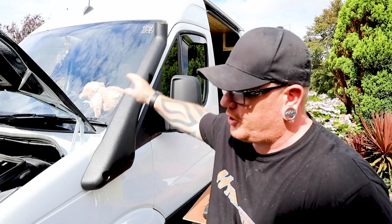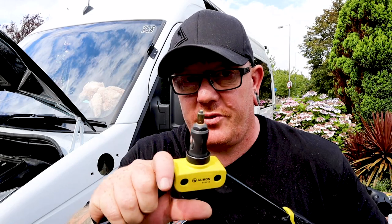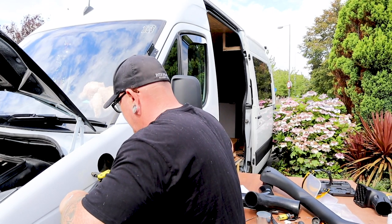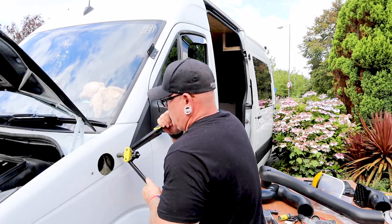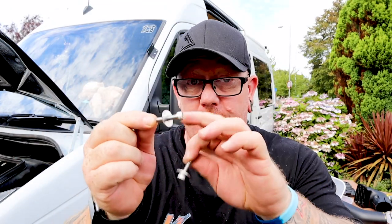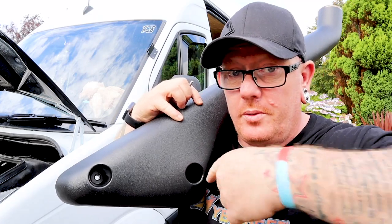So I've just put one of the bolts in the top, then I can actually get in there and mark this hole where the actual rivnuts are going to go. I know that everything at this end is lined up to that end and it's all perfect on the van. Two M6 rivnuts come with the pack. If you don't get rivnuts I'm sure you can find another way, but rivnuts are the way to go — so pop them in. Once you've got your rivnuts in, it does come with two hex bolts, or allen key bolts, with two washers as well. Those bolts and washers go right through there, so you're going to need a long extension to go through to get them bolted to the body.